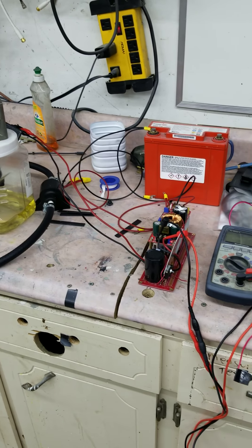I've also built a circuit because ETEC injectors require 55 volts in their system. This little circuit is a DC-to-DC converter that boosts 12 volts up to 55 volts. I actually run it around 35 to 38 volts — it seems to work fine. I'm just trying to generate less heat.